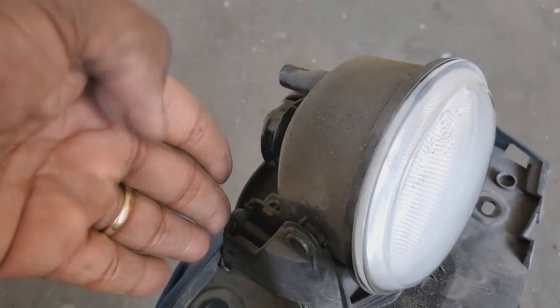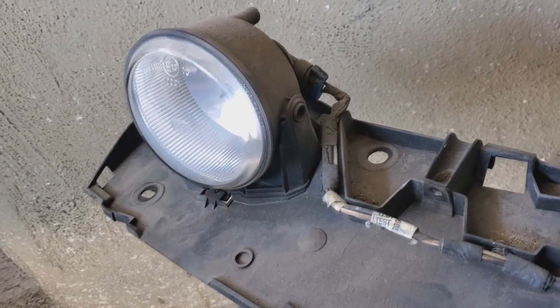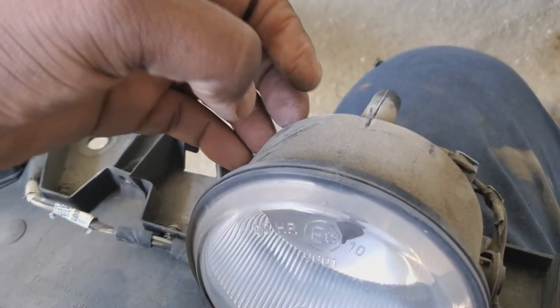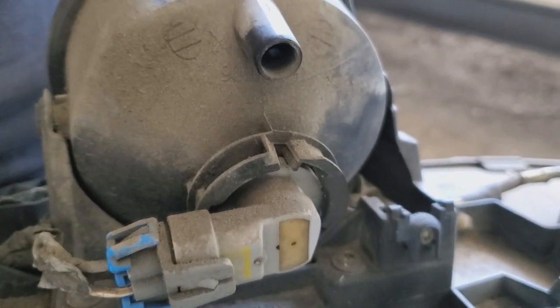So you'll be able to adjust up and down all four of your lights. And that's really awesome because it allows you to have something personal for how you want these to operate, as well as allows you, in our case, to put it on other vehicles besides just the Liberty, okay? So that's just something I wanted to show you. That's what we call a bonus, that these are adjustable. You can see it's on the little piece right here and it could twist up and down. Right now it's not moving because this screw holds it in place really well, which of course is what you need. And it's just like a regular headlight on your car, how it would have an adjustment pin. And when looking at it from the back, the pins are on the right-hand side of the bulb housing on each one. All right.